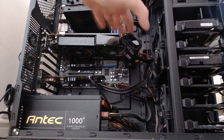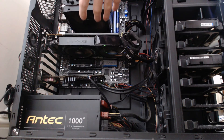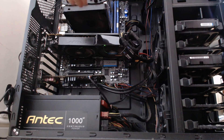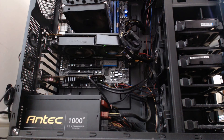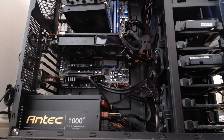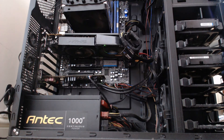So you're likely going to get a pocket of air between the graphics card and the heatsink. This is especially true if you have a really large heatsink, because it's going to block heat from just flowing upwards. So you're going to want to configure your fans so you are sucking hot air off the graphics card and depositing it out up to the top where it's being sucked by the case fans at the top of the case. You can also have it the other way around — sucking in cool air and depositing it out the back. You'll definitely get better CPU cooling with that, but not necessarily better overall case cooling or better graphics card cooling. So that is top priority if you've got a really high performance graphics card or a really big CPU heatsink. So now we're going to put the side of the case back on and run some GPU and CPU intensive processes and games, then get back with the thermal camera and have a look.